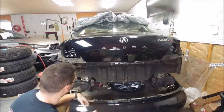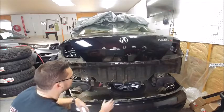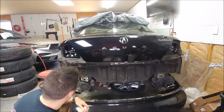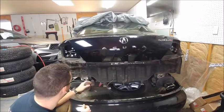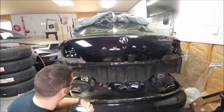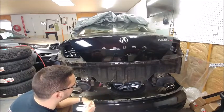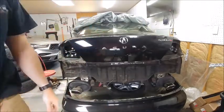Let's talk about where we're at right now on the rear of this car. To get the bumper off, you sadly have to take the rear taillights out because there's a screw that goes to a little plastic bracket on each side that prevents you from pulling it out cleanly — it's better not to break anything in the process. Right here and right here is where the bumper bracket goes on. There was significant rust here that has now all been ground down — I took a grinding wheel to it and cleaned it all up on both sides. This side a bit more because, in the process of taking out the rear support beam, a stud snapped, so I now have a replacement stud in place.